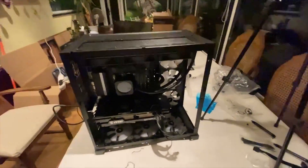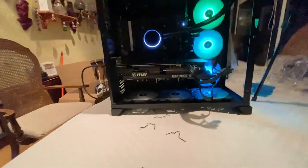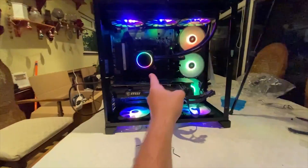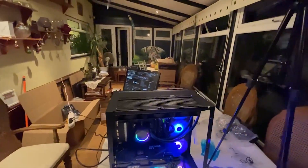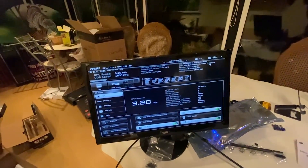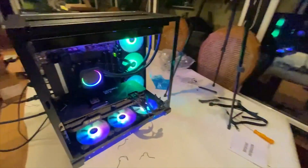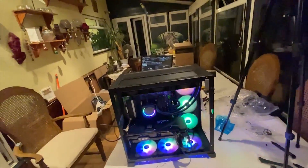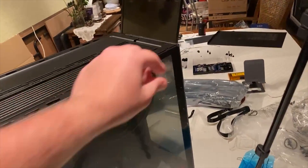Attempt number three — waiting for the RGB to come on. There's a white light we didn't have before. All the fans are on, the BIOS is displaying, and CPU temperature is at 21 degrees — much better than the 40 it was at before. Temperature is even going down. That was the issue — the pump wasn't plugged in properly. Everything works now. Doing a bit of cable management, closing up the case, and getting back into the BIOS. Still holding at 21 degrees — definitely fixed.